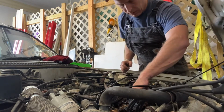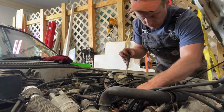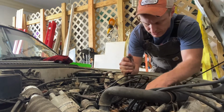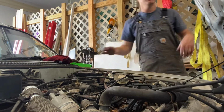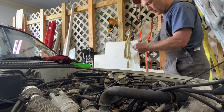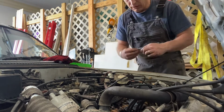Okay. Exhaust is opening, so we're going to do the intake side here. What we do is put your screwdriver in the slot, loosen the nut, so that way you keep that slot in the exact same space and you know where your initial setting is. Then you find your feeler gauges that you didn't get out yet. And you find your 15 thousandths, give or take one. There we go, 15 will work.